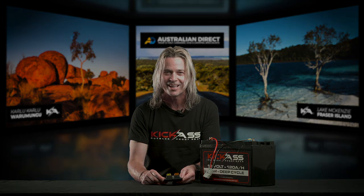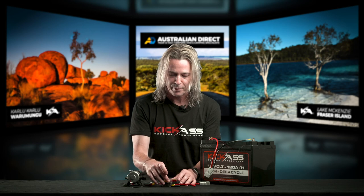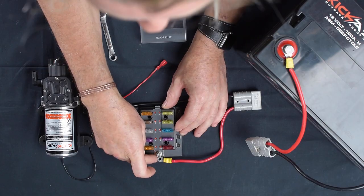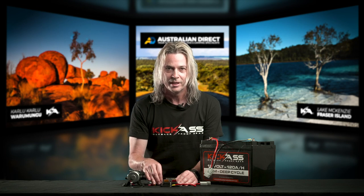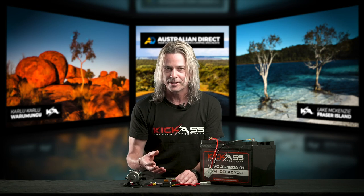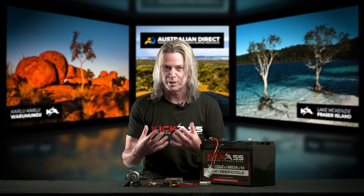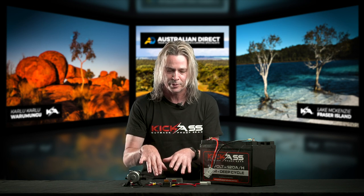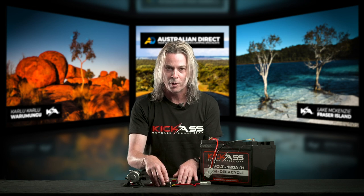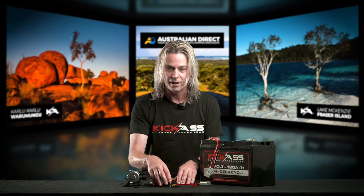I'll quickly show you how to wire it up. Basically what you need to do is run your positive power to the 8mm screw here, and then you've gotta run your own earth. So, you know, caravans, camper trailers, everything that doesn't actually have a chassis earth, whether you wanna make an earth or a bus bar up, however you wanna do your earth, your earth is gonna be separate. So this only works through the positive side of the voltage.